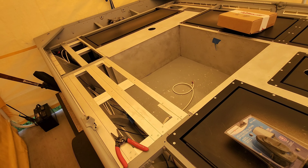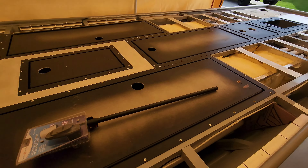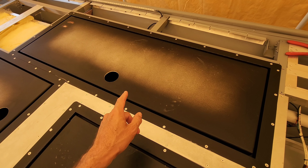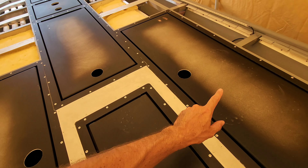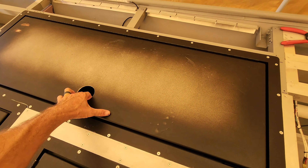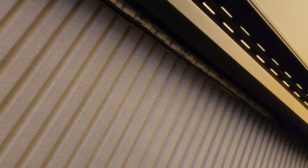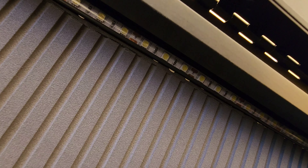The rear stern light I get from Academy Sports — it's the only thing I drive to a store for because I haven't found the greatest ones on Amazon. It's adjustable height, telescopic, and comes with a mount. This will get mounted after decking and turf. The lead from the nav lights and the lead from this stern light will wire onto one switch.